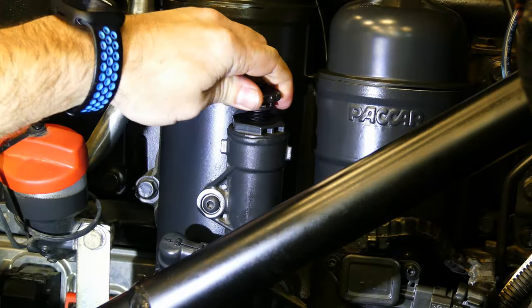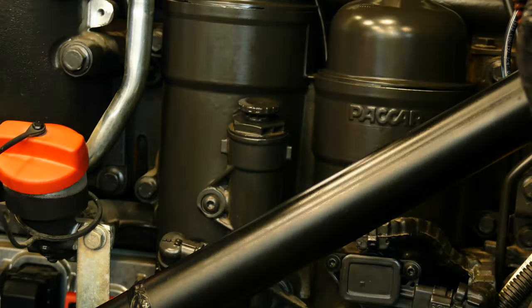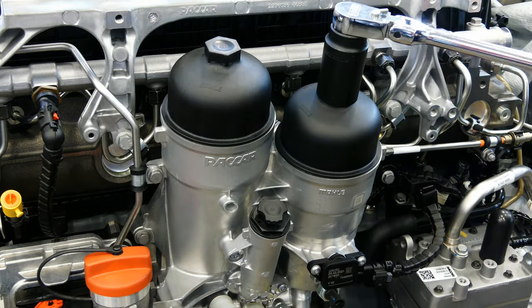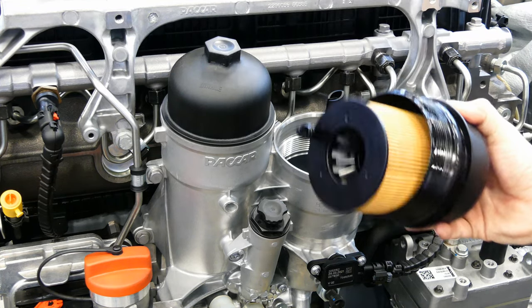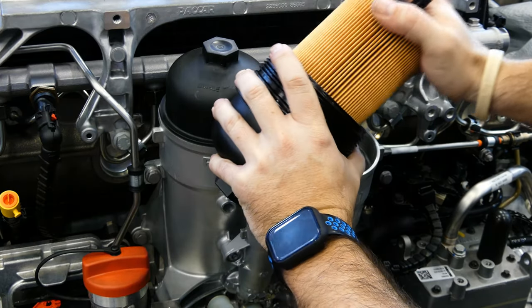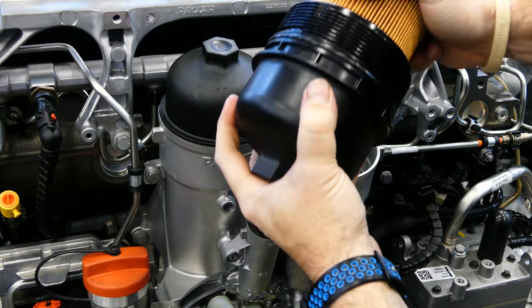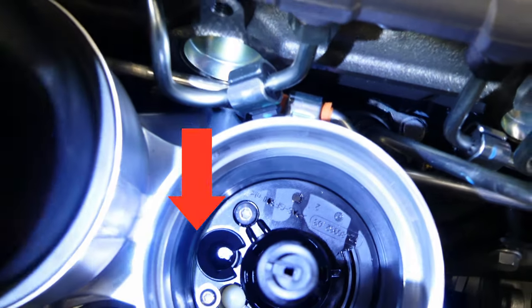The new hand primer pump has a longer stroke so you shouldn't have as much trouble with it as previous years have been known to give. Filter removal is straightforward. Starting with the primary filter, previously known as the chassis side filter — the filter is locked into the cap when you remove it and you'll need to separate the two. It free spins in the cap so grab both and pull them apart while twisting slowly. You'll feel the filter pop out just a little bit when it finds the sweet spot, then twist the filter to the right while pulling. It's a bit tricky at first but you'll develop a feel for it. To lock it back into the cap you twist to the left. Down in the module you'll see a hole for that dowel on the filter — make sure that is aligned correctly before tightening the cap.